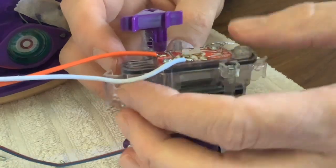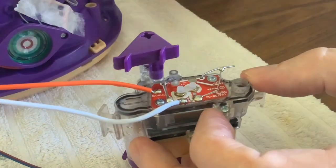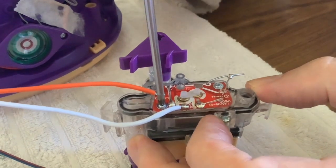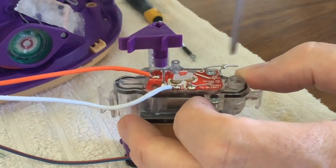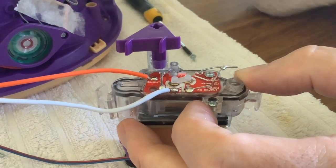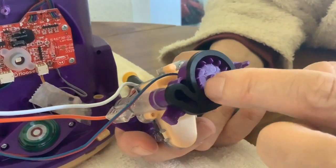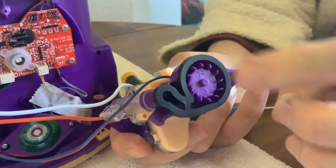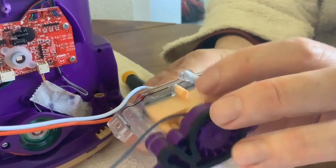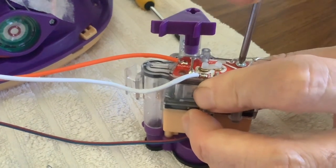We would have to take it apart further. These two wires are definitely supplying current to the heating element, and the heating element looks like it might be on this red circuit board. The fan on here is designed to pull air in by rotating and push it up past the heating element on which the glycerin is dripping. It's the sort of fan you might get on a 3D printer - the blades are vertical and on the outside, so it doesn't look like a normal fan. They can generate a higher pressure - they've got what's called a high static pressure.